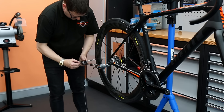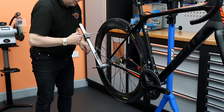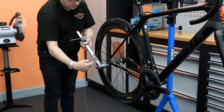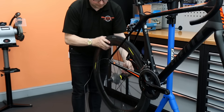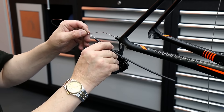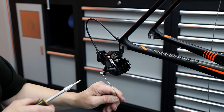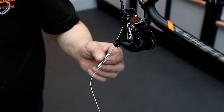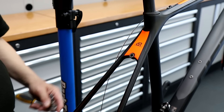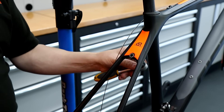I'm going to adjust this rear derailleur hanger — it was a little bit bent. I used the rim of the wheel to get it square, checking it across four points on the rim and getting it absolutely spot on before fitting the rear derailleur. This bike wouldn't have shifted well when it came in due to it not being aligned — I see a lot of bikes that won't shift smoothly because of a misaligned derailleur hanger. Now in goes the new cable; this whole bike will feel completely different with far more sharp shifts from all the new cables.